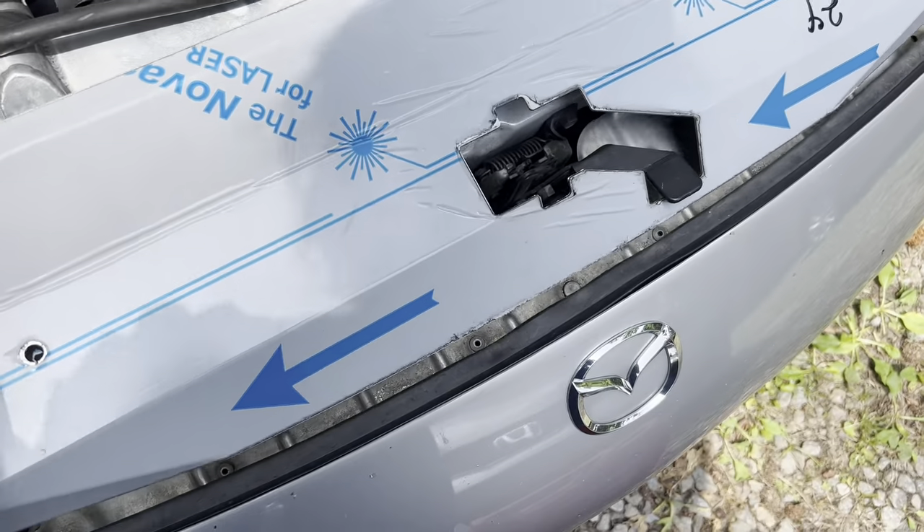What I noticed the last track day is I was running very high oil temps, so I'm hoping that this in conjunction with a hood vent will help with the temps underneath. While the temps have been fine — I didn't hit any peak alarms or anything — I'm just trying to see before I invest in a whole oil cooler setup.